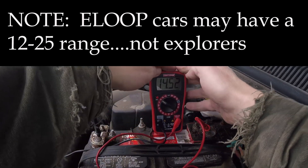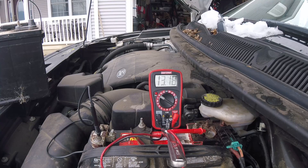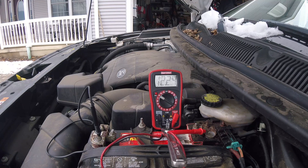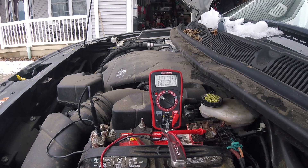Now let's see what happens when I shut down the car — see how strong the battery is. Look at the volts drop on that thing, dropping pretty fast. It's holding at 12.2... no, it's dropping. Going to turn on the headlights and see how fast we can drop this. One technique to check the battery is to turn on the headlights for two minutes and then see how much the battery drops. There could be surface voltage on the battery giving a high number, but after two minutes with the battery under load with the headlights, we should see if it drops below 10.